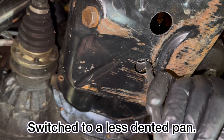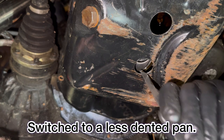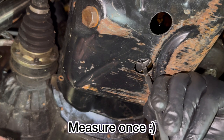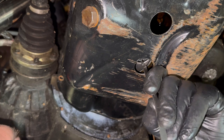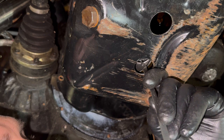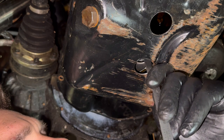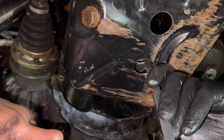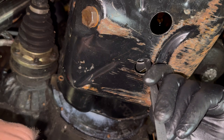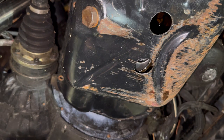There are two holes drilled because I measured backwards - so we're not saving inches here. I thought we were going to save a whole inch, maybe an inch and a half, which is a bummer when you've spent $400 on an oil pump. But it's all good. We're at 19 millimeters away, so we have to subtract 18 millimeters to get it to 1 millimeter away from the pump face - one nickel distance.